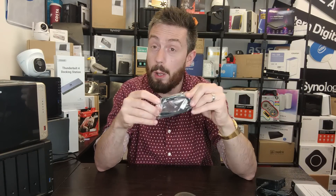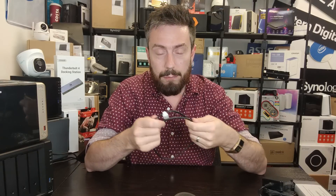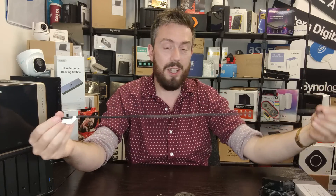It also arrives with a Thunderbolt 4 cable. This is important because Thunderbolt 4 cables look nearly identical to Thunderbolt 3 cables — the only main difference is they've got a '4' on the label. They're also USB-C. The benefit is you get better performance over distance with a Thunderbolt 4 cable, and it can maintain performance while supporting more features internally than Thunderbolt 3. If you're replacing cables in your Thunderbolt setup, get a Thunderbolt 4 cable regardless — the benefits are felt even in Thunderbolt 3 protocol.